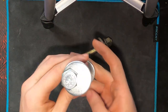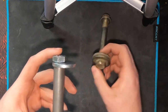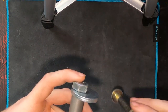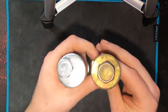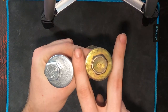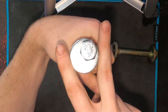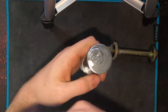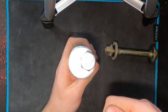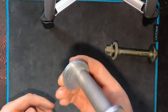When it's in, it actually pushes the arm further in one direction than a standard bolt would. The way that it mounts on the frame is it's retained between two notches right here. The bolt can rotate within this to adjust where the arm is in orientation to the mounting point. So basically you go to the alignment rack, they get a wrench and they twist this — it pulls your arm in and out of the frame and adjusts your camber and caster.